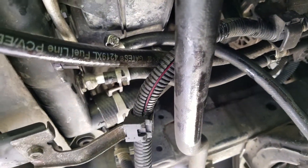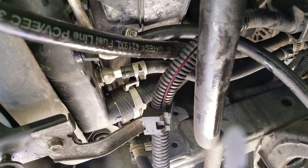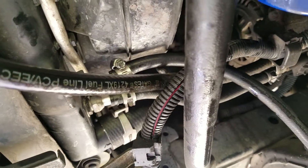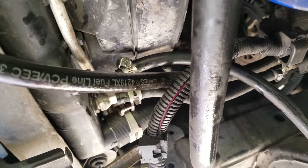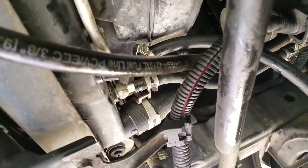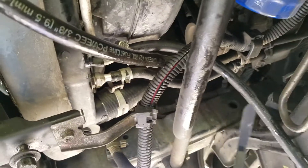If you want, you can disconnect this hose and connect it — this is your drain. The other one goes back into your transmission. Basically, you're just pumping the new fluid back into the transmission while the transmission is pumping the old fluid out. You're using that power steering pump to pump it back in — that's it, one for one.